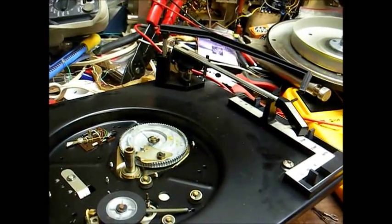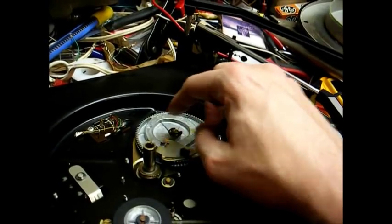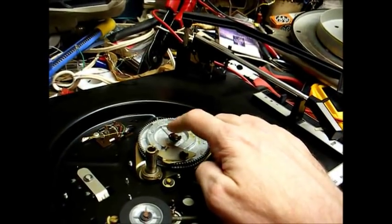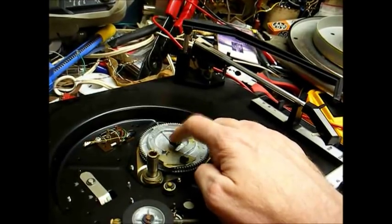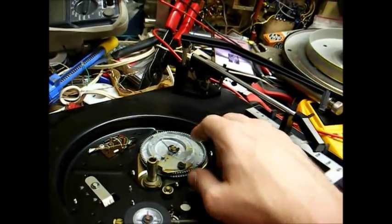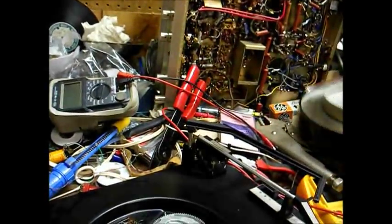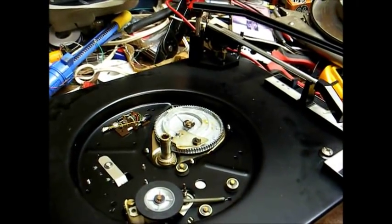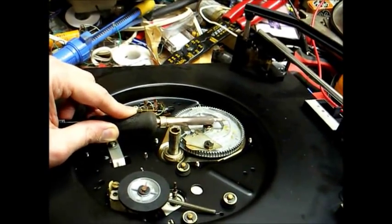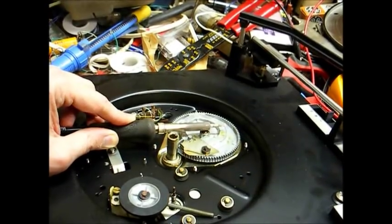We remove the cycling gear just like we did the turntable platter — remove this clip here, apply a little 3-in-1 oil to soak down in there, and apply heat either from the soldering iron or from a blow dryer. I'm holding the soldering iron in place to get the shaft hot, which will in turn loosen the old hardened grease. Note that on many of these BSRs the platter is made out of plastic, so you want to be careful when using heat.